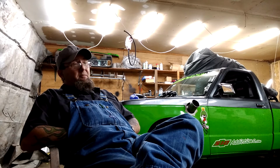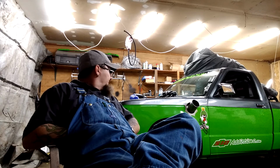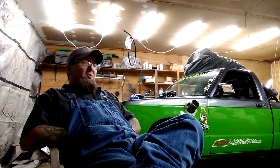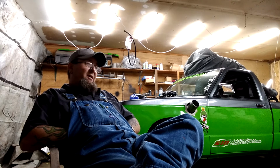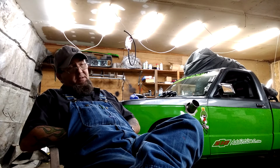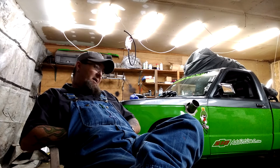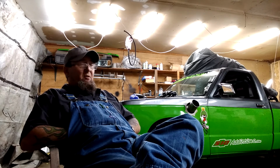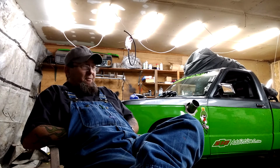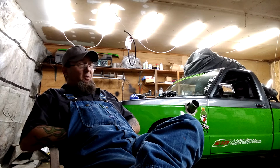In street trim, it's got some of them black 5-spoke aluminum wheels on it. It's got Hoosier front runners on the front, 26s. It's got 555 Nitto drag radials on the back, 275/60/15, when I drive it on the street. If I ever go to race it, I do have a set of beadlocks. They're Billet Specialties. Just an inexpensive beadlock. Don't know if it needs them, don't know if it don't. My son's actually the one that bought them, so we got some Mickey Thompson slicks for it.